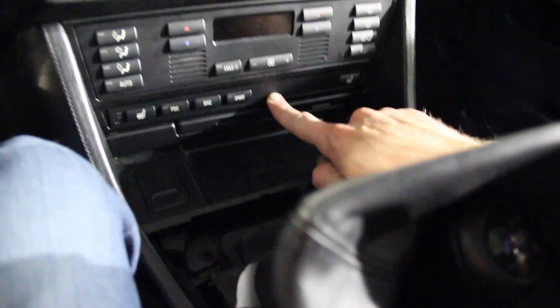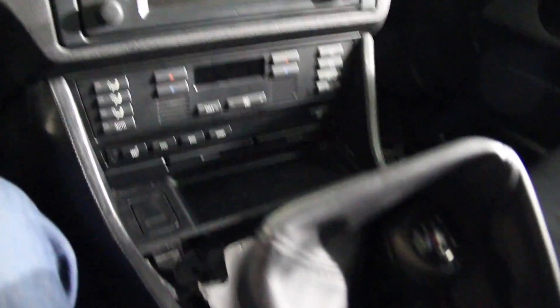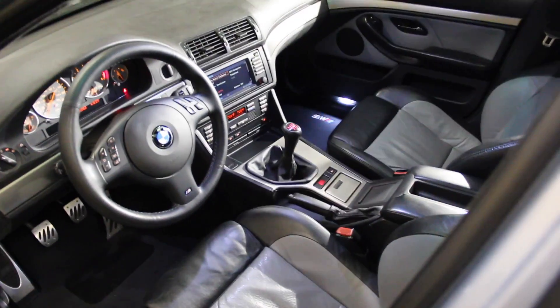At this point you can lay your tray back in here. Make sure you route the clear wire for the electrical power and run that out so it can plug back into the vehicle harness. Then start with the cup holders, put them back in, put the button panel back, and connect everything on the HVAC panel and push that back into place. Reassemble everything the opposite of how we took it apart — it takes about 10 minutes to get everything put back together.